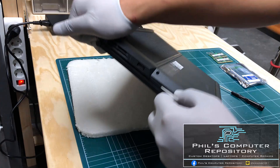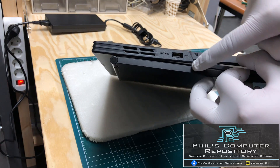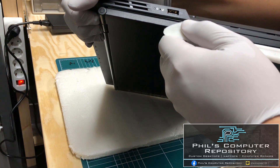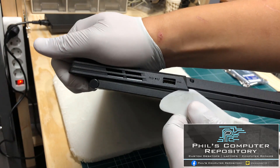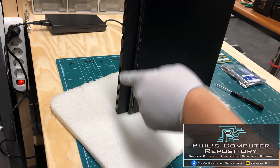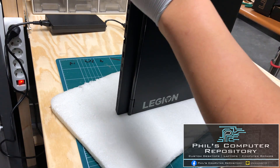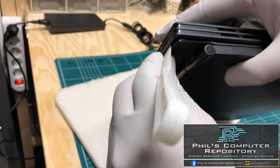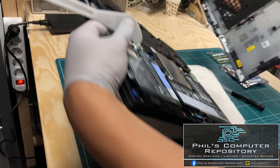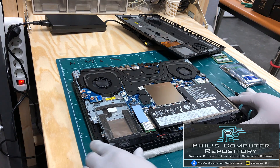I want to get my wedge in and pull slightly upwards. You can see the seam on the upper half of the laptop is at a slightly different cornered angle, so I'll get the wedge in here and just keep going along the edges. At the back, same thing — put the wedge in the corner, and once you're in just slide down. The whole thing should come apart — it's actually a bit simpler than my last laptop assembly video.